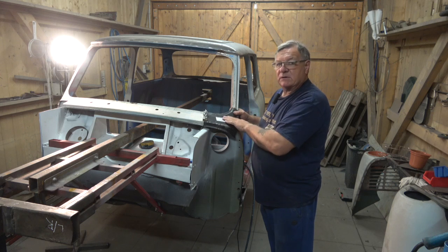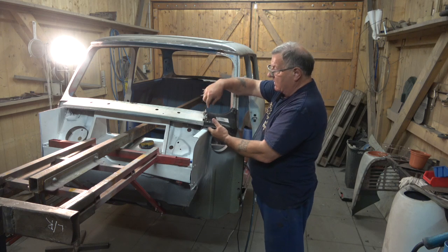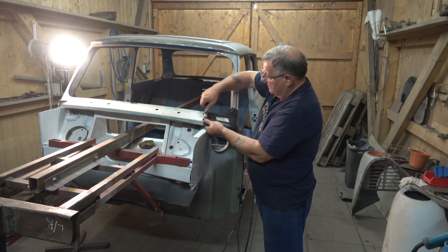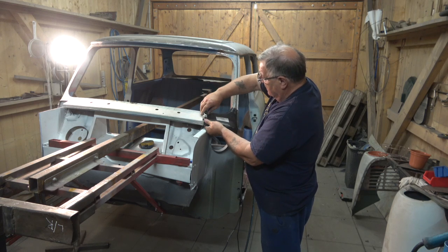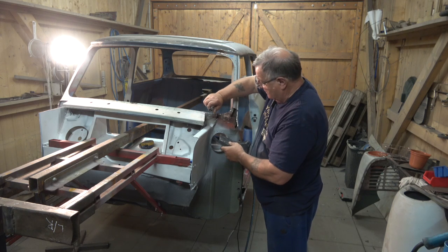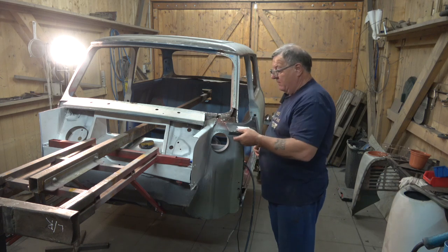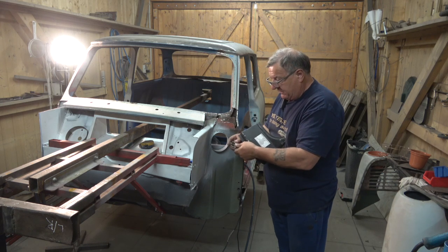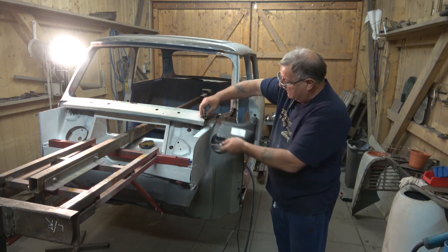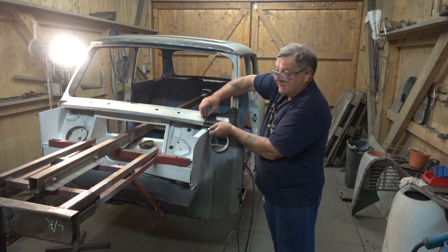I need to repair underneath, so I have to do that first. But you can see now, in a situation sometimes you can't always get these Intergrips in. There are other methods. You can possibly undo them and move the piece into it like that. You can see that one's come off. You can even, if you can't get behind it for whatever reason, just use the Intergrip like this to get everything flush and use it as a gap guide.